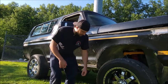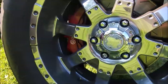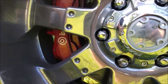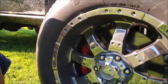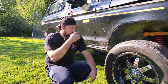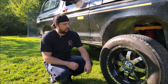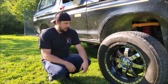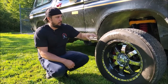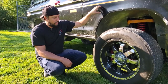We have six-piston brakes going on up front here. These six-piston brakes you might recognize from a Hellcat. To get a Hellcat six-piston brake onto an F-150, basically we had to turn our rotors out, cut our hubs down, remachine the face, change the whole hub, add six lugs, build a custom mounting plate for the back, and engineer that to fit the spindle.